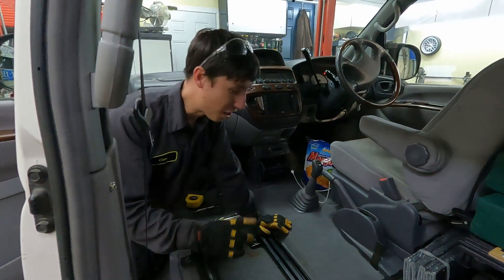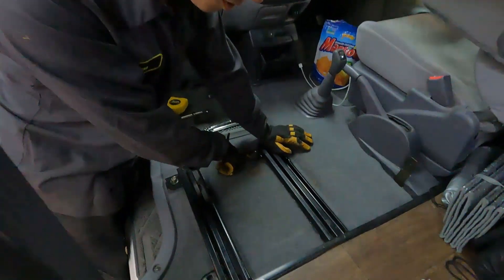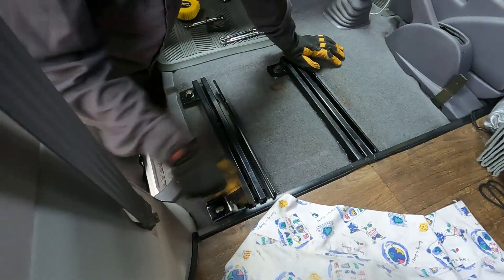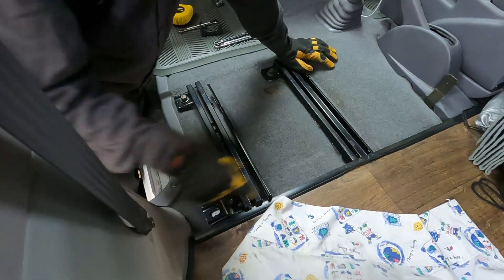I think I figured out what we're going to try and do here. The fronts are bolted in and I've cut off the original brackets. That bracket will mount here — we're going to use a piece of quarter plate to weld it in and keep it nice and strong.